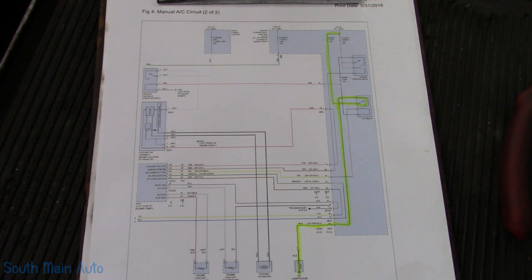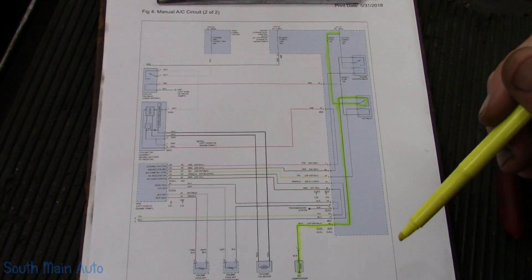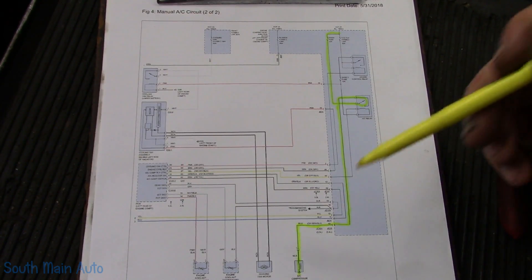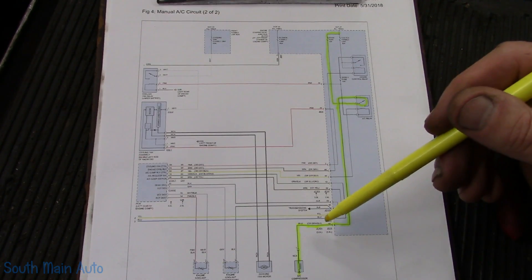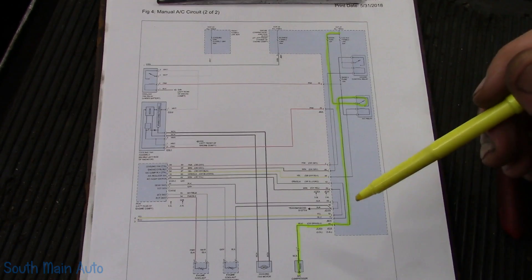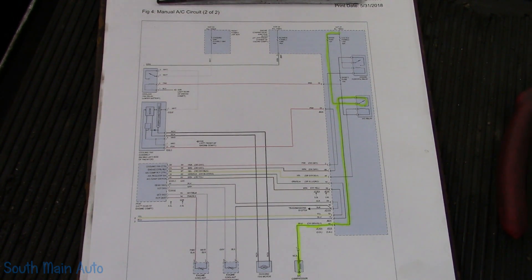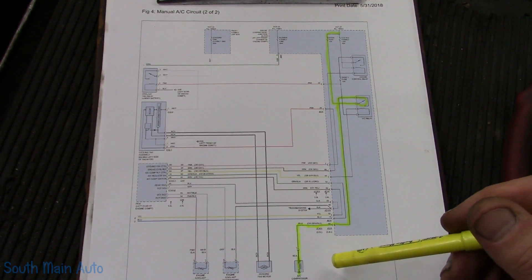These field coils are usually only an amp or two — maybe three or four amps on the average AC compressor at most. Can it be a bad ground? No, because resistance goes up, amperage goes down — a bad ground means no complete circuit. So the possibilities are essentially a wire rubbed through somewhere, spiking the amperage when the engine torques, or the field coil is starting to short — particularly as it gets hot. That's my suspicion, because each time it blew, it was after an extended period of driving.